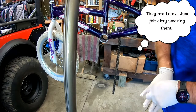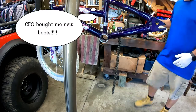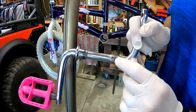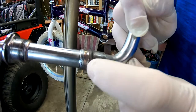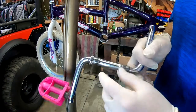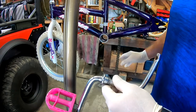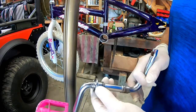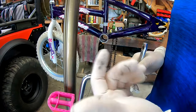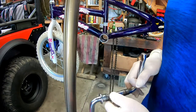They gave me larges so they're a little snug. This is the crank right here. If you look right there — that's the main problem we have: all the threads are pretty much gone. What we're going to do is put a spacer on this side and just move it over a little bit. It shouldn't mess up the chain alignment much, but it should get us into some decent threads. I took a big washer and wallowed it out a little with a unibit. Let's put this back together and grease up the bearings.